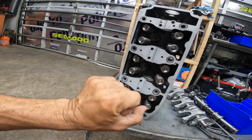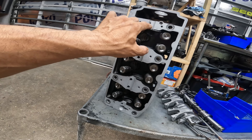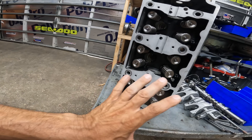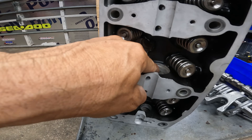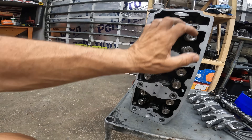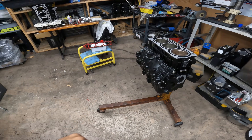Four to six days later — we got the head back from the machine shop. They said they had to put it in the machine three times because they wanted to be 100% sure there's no sand in it. They also went through all the threads to make sure there's nothing in the threads. When I took it back, I washed it myself, put soap in it, went through the threads with the bolts that are supposed to go there, blew on it, nothing came out. Feeling pretty confident this is clean. Now, this is not a very good head — you can see right here the scoring where the cam goes through. That's okay — these get so much oil pressure a little score in there is okay. There's a reason why Rotax doesn't put a bearing there, which tells you it's okay to have a little scoring. These things have like 100 PSI of oil pressure. Pretty much confident this is gonna work.